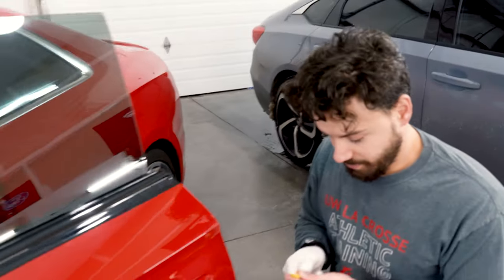Peel back — this is the liner that comes on top of 3M films. You can install with it on; it prevents you from scuffing or scratching the film during install. Big sheets of 3M, whether it's a full color change or anything else, all have this on it. I finished the cut, so go back to where I started — there's a little bit of a lip still there, which I'll take with my fingernail and tuck underneath. Then heat everything to seal it in. Use your fingernail to outline the corner, then take your blade and make a very fine little cut to start it out.